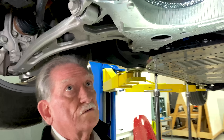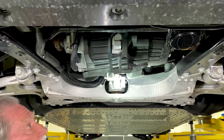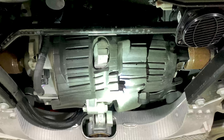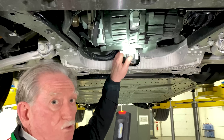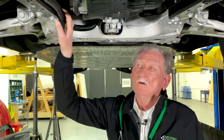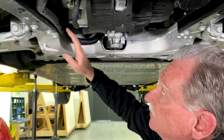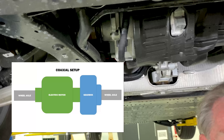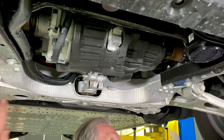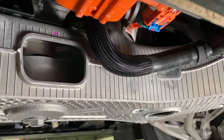Let's look at the motor. This motor is really short compared to the back. Our guess is it's probably an induction motor or a really small PM motor. This car has two motors on it — I haven't driven it yet, but others say it's quick, really quick. One of the nice things about this electric motor from a drive standpoint is that it's coaxial, which means you get rid of weight and cost and get a lot more room.